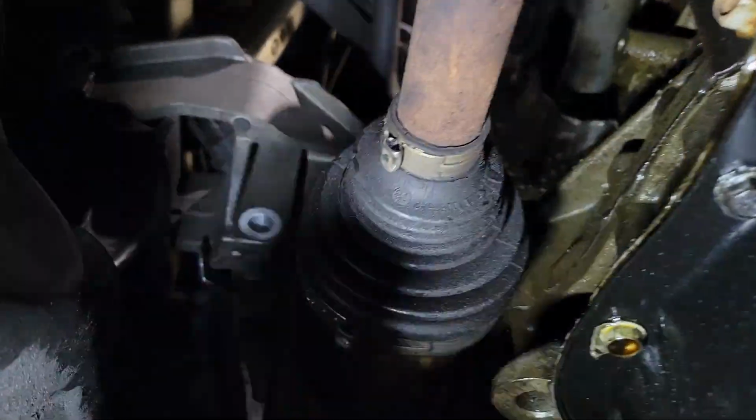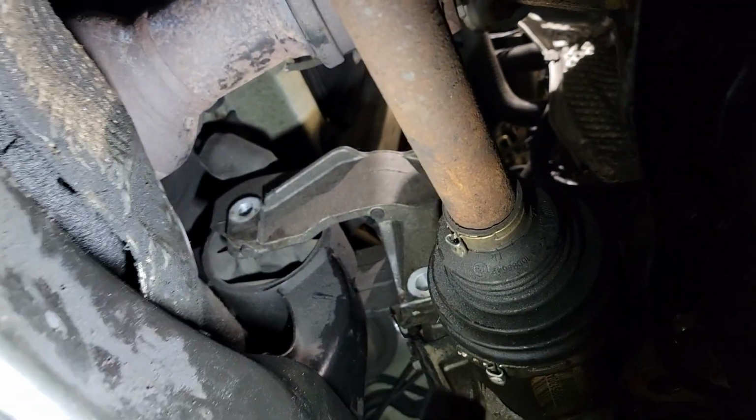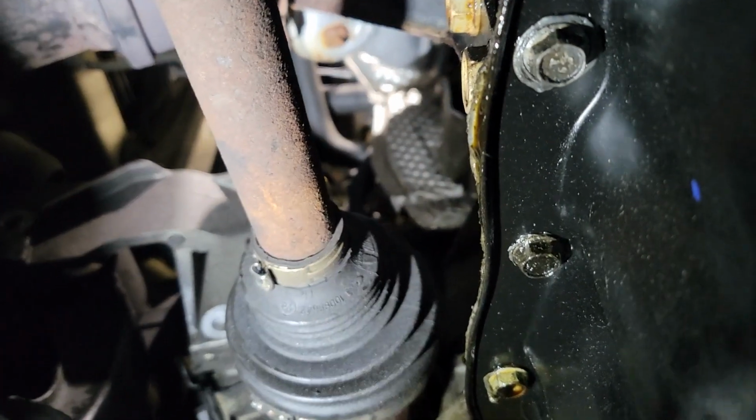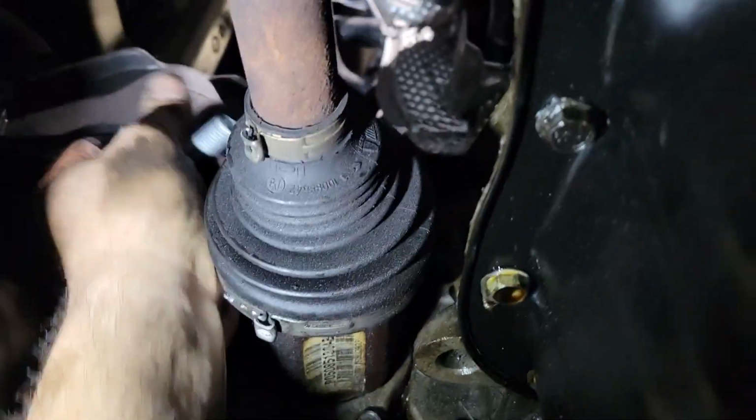millimeter and it goes right there. That was a 15 millimeter that went through the engine mount. This is like a bell housing bolt that goes into the block. We're taking it out so we can move this, because you can move the mount around a little bit now, but there's no way to get it out. Let me see if I can show you.